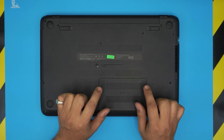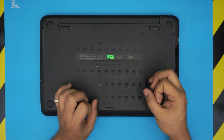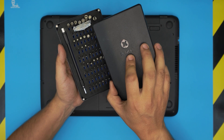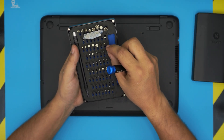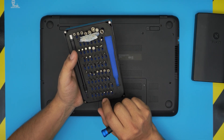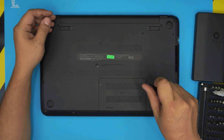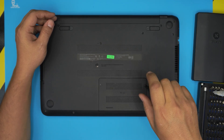There's a simple service cover right here for the battery area, held by two screws. These two screws have a C-lock on them, which means they will not fall off. To open it up you need a screwdriver set — I use the iFixit tool set because the bits are S2 class steel, tough and suitable for opening electronics. We're going to be using a Phillips number one — go ahead and loosen up those screws until you hear a click.